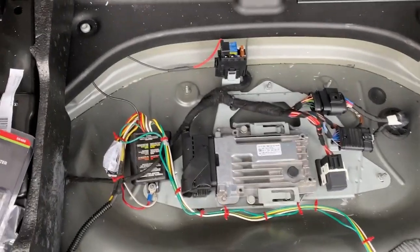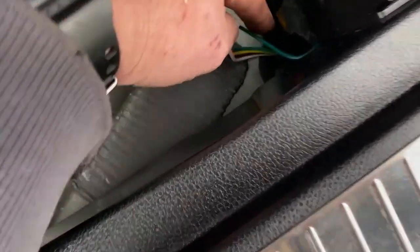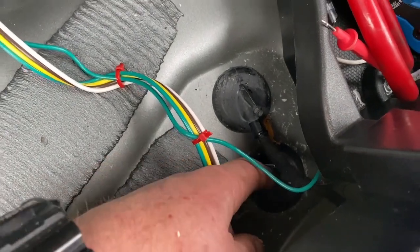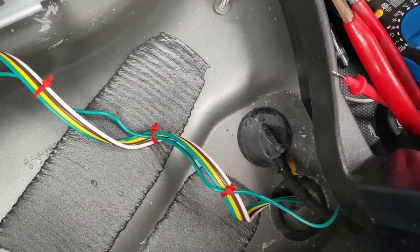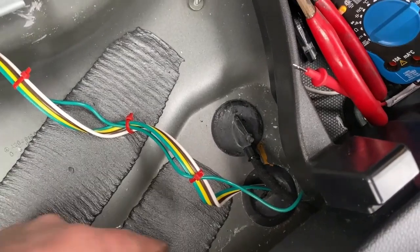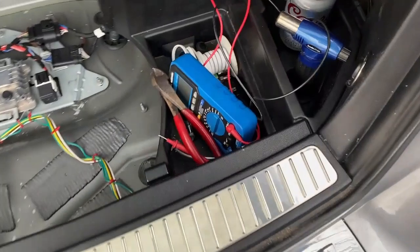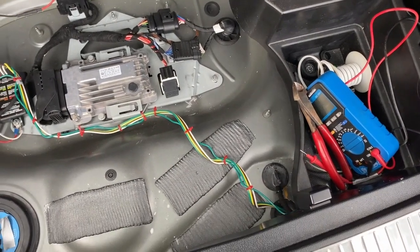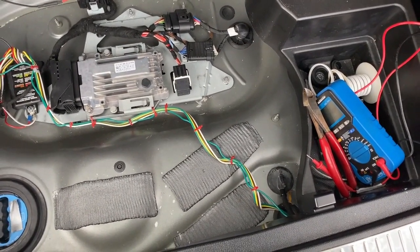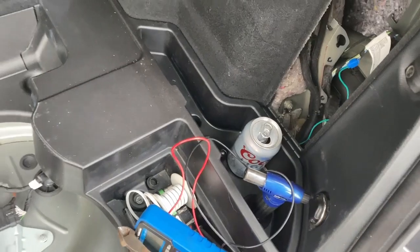The wiring is mostly tidied up now - it's a little bit of a jumble but fine. One last thing: there's a little bung plug at the back - I'm not sure what it's for on the diesel - but there's a little body plug there that you can pull out and it goes straight down. That's where the wire runs out to the trailer hitch. Just cut a slit in it, poke the wire through, and silicone it up once you're done and have your proper length sorted.